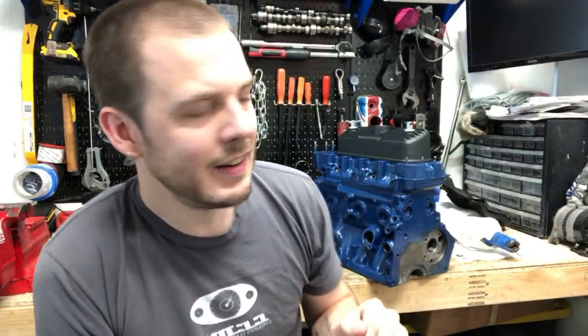I've changed gearboxes. I'm assuming that is boxes. Yep, boxes. In the past, for good used ones, but never had the nerve to rebuild one. It really wasn't that bad once you got in there. Paul Jeffries says Mini Mania has good YouTube videos on how to dial the camshaft in. And I would agree, they have some good information. There's one video I watched recently where a guy and his kid were doing it, and I found that to be the most helpful so far. His son was doing the calculations, and he was doing the majority of the degreeing and everything.